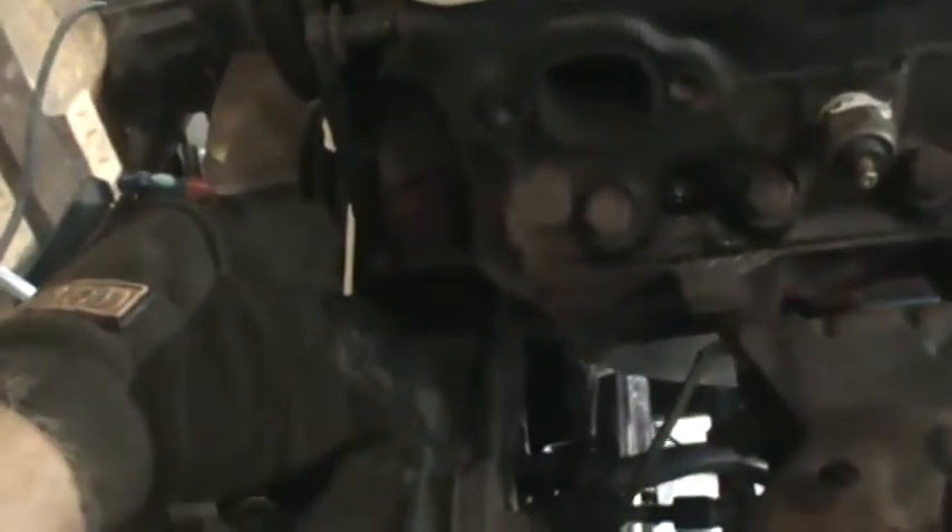I'm not having any luck doing all this at once, so I'm going to put the camera down and get the wrenches on it. I got access to that bolt in the back from underneath — that's the easiest way with those hoses in your way. Once I got that loosened a little bit — by the way, it was a 9/16" on the front end — it pretty much allows the power steering pump to move in towards the center of the engine, and your belt can come off.